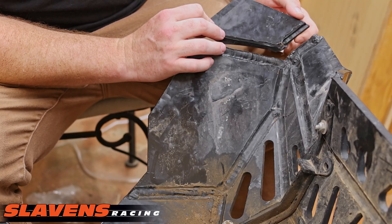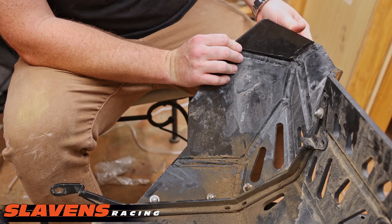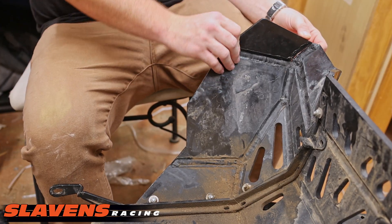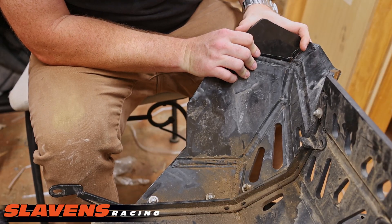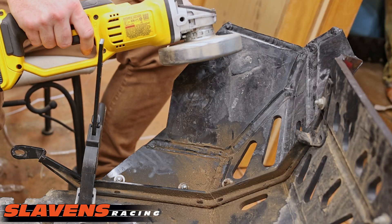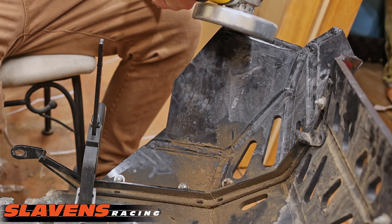So with that, it has broken along that bend. We've got to get it to sit back in its same spot, about like this, and we need to make sure that we have enough room on here that we can plastic weld it back together. I've got this clamped in place so it's at least moderately safe, and we're going to open this area up to get more exposure for the new plastic welder we're going to place.